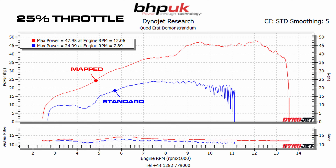The customer has already told us that the bike is very, very lumpy at the top end. It gets to a point in the RPM range where it runs quite well, but then at the high end it starts to bog again. It's something we will look at — it will be in the fueling — but let's see what it's doing on the dyno and get some figures before we tune it up properly.